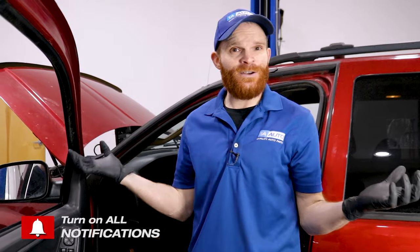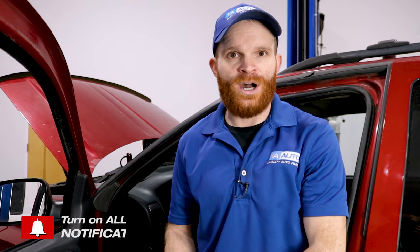Today we've got a second generation Jeep Grand Cherokee in the studio. I wanted to go over one of the issues that I'm having with power windows and go over the steps that I'm going to go through to diagnose the issue. So first we need to figure out exactly what's going on — is it one window that's not working or is it multiple windows? For my particular issue, I've got no power to any of my windows right now.